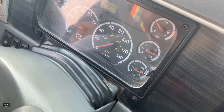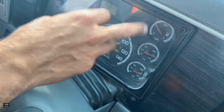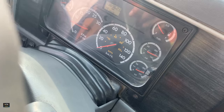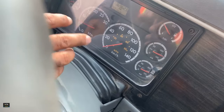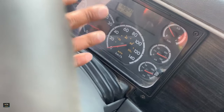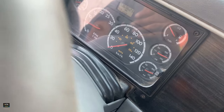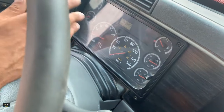I heard the sound from the air dryer and the needle stopped moving at 125 PSI. On this truck the cutout happens at 125, which is good because it's less than 145. If it happens above 145 or doesn't stop at all, that's bad. Make sure the cutout happens well before 145 PSI.